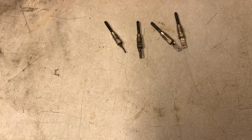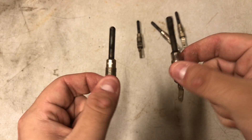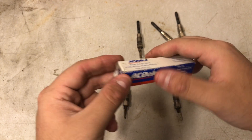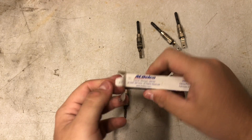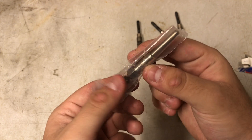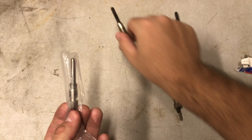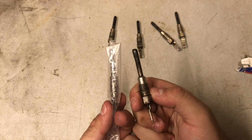Make sure it says AC Delco right on them. There are other brands you can get too, but I prefer these and so does Jared. The one on the left looks okay — it came out fine. The one on the right is kind of swollen. That can lead to a problem. If they've been changed out routinely, normally you won't have swollen ones in bad shape. But some of these may not have been changed out for a long time. Now this one here looked like it had been changed out not too long ago — some soot, maybe some carbon buildup. This one — oh boy, that's swollen, and that ran into trouble.